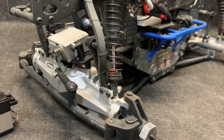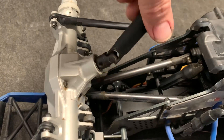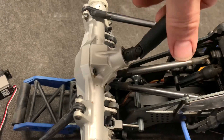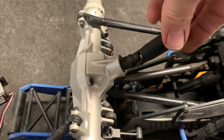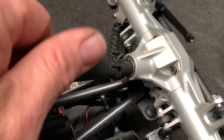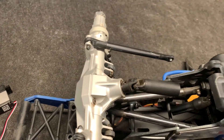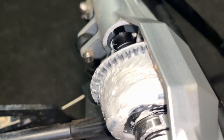I'm going to get the drive shafts off and just listen to these axles to see what I may need to do. You can absolutely hear the gears mesh but it's not binding - almost like the pinion gear is too far in or too far out. I'll pull these off and see what we've got underneath. Maybe there'll be a wear pattern on the pinion gear itself and I can get an idea of what needs to happen. This is the front side right here.